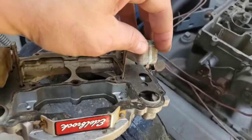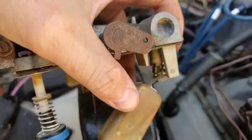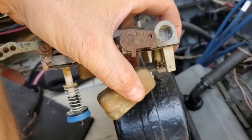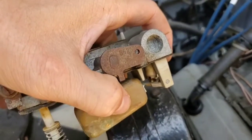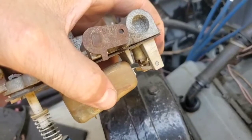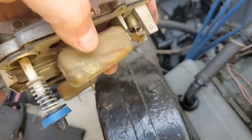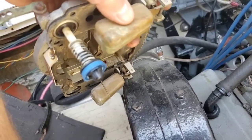These guys are your fuel floats. As your fuel pump pumps up the fuel bowl area, the float floats up, and you can see the little needle that moves in the back. As it goes up to the top, it blocks the port that fuel flows out of. So fuel fills your bowls through the back, and as your carb uses fuel, it opens and closes the valve just based on this thing floating. I've heard of these getting full of fuel and not working correctly — check right when you pull this off. If one of them is heavy and one is not, that's a problem.